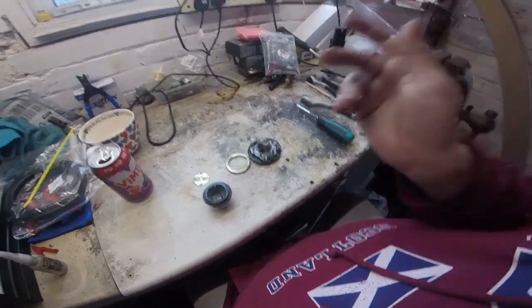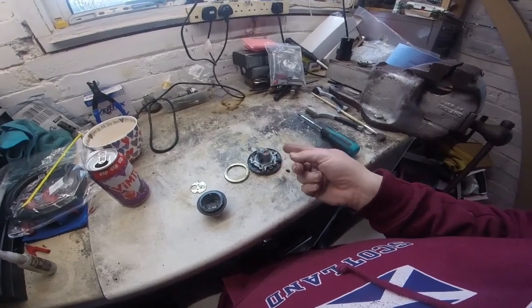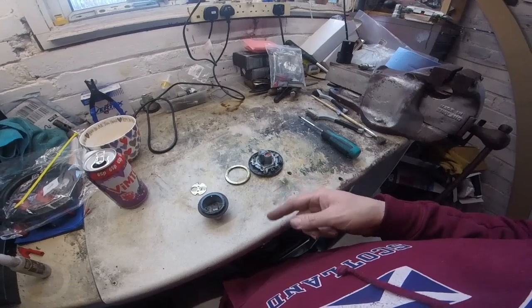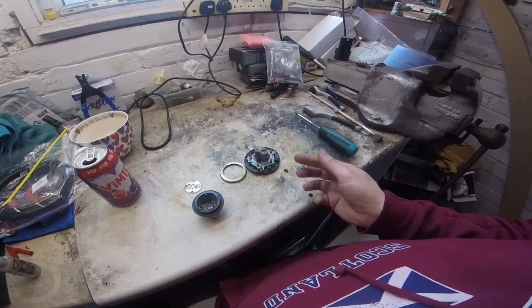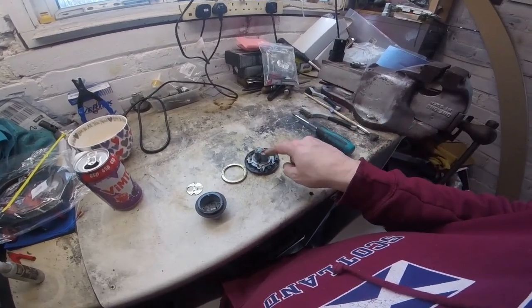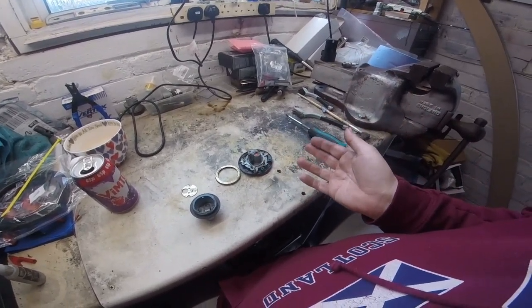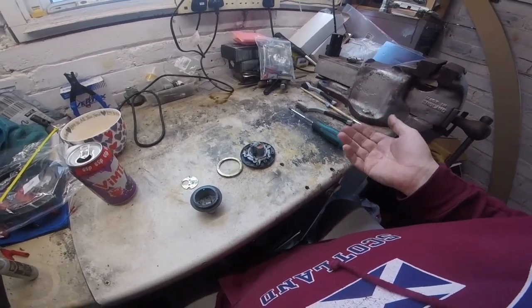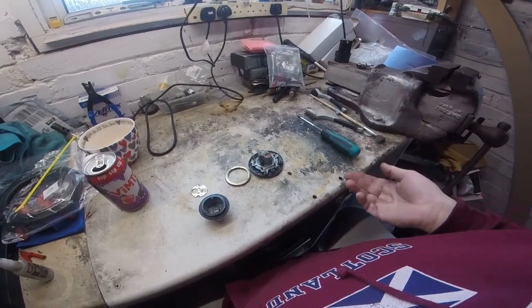bath. Because what happens is, if the fuel cap or your fuel vent on the tank can't breathe, it leads to fuel starvation. The pump will overcome some of it, but not all of it. The pump is only rated to 3 bar, which is not very high at all. So if one of the symptoms is the bike will start fine and run for perhaps a few seconds, maybe a minute, and then it will conk. And then if you leave it a while, it will start and it will conk, and it will start and it will conk.